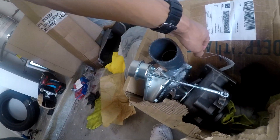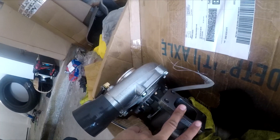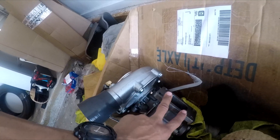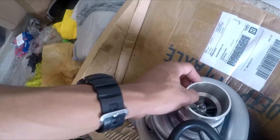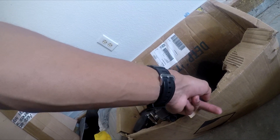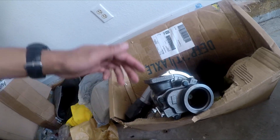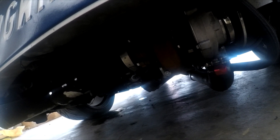The first thing you need to do is figure out how you're going to hook up your turbo to your exhaust. I have a little T3 turbo here — this is just a backup or to try out for quicker spool. This is the T3 flange. Most people will have custom headers with this flange so you can bolt the turbo directly on. You want it to catch exhaust flow to spin the wheel and compress the air, then send it into your engine, with exhaust gases exiting through the rest of your exhaust. You can actually mount the turbo anywhere on your exhaust — if you're new to my channel, I actually have a rear mount turbo setup.